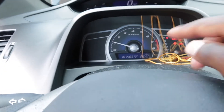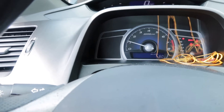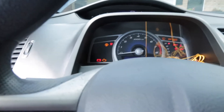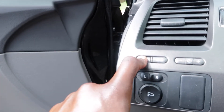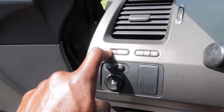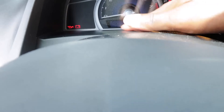All right, everything is done. Now I gotta get my keys and turn the car on to reset it back to 100%. You can see it says 60% oil life. Turn the car back off, then hold this button down for ten seconds. It blinks, then hold it back down for another ten seconds, and your oil life is back to 100%.